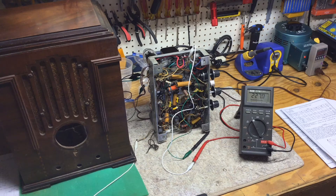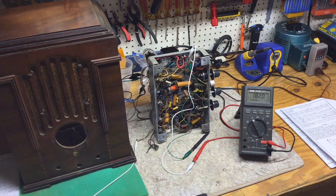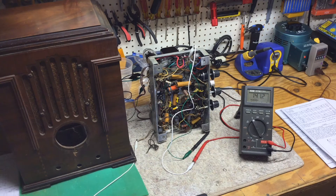I'm at 227 volts DC and we should start seeing voltage drop. My current stays steady at 0.14 amps — that's a good sign. One thing you can't see in the video — I do have one of the pilot lights lit, so that's always a good sign. You can see my DC voltage: there was that inrush current, and then you can start to see it drop off, which is to be expected. I'm still at 0.15 amps of current. My DC voltage is around 125 — I'm shooting for about 300. We probably won't hear anything out of this radio until we get the plate voltages up in the 200-plus range and the AC line voltage up to around 85 or 90 volts.